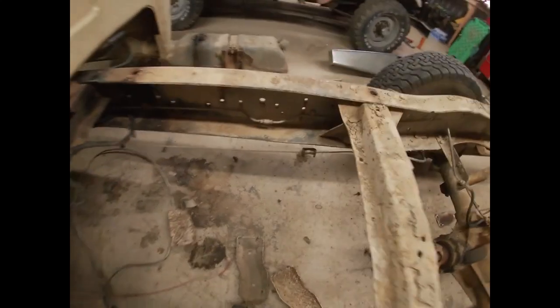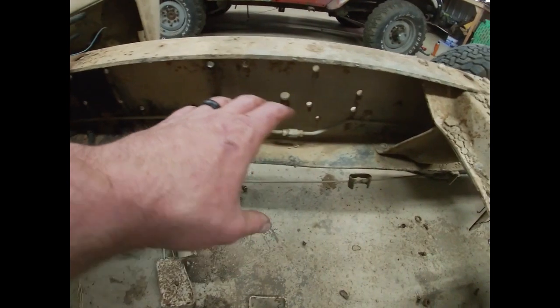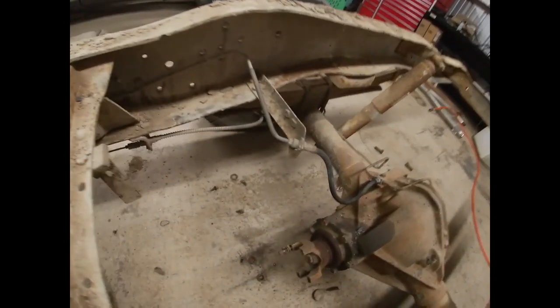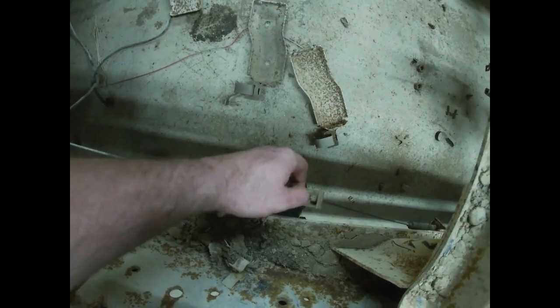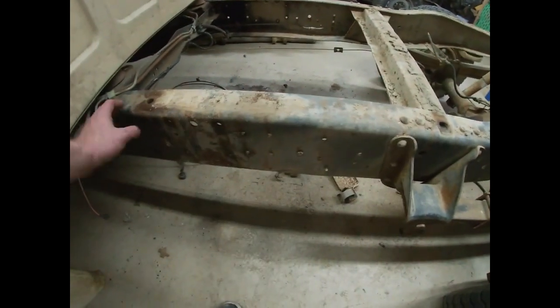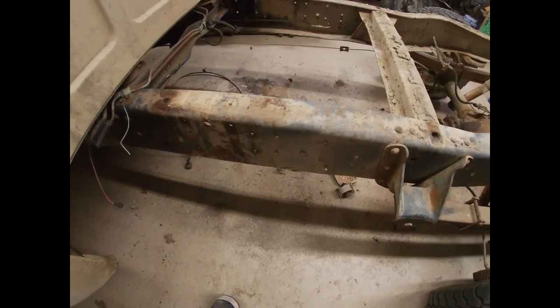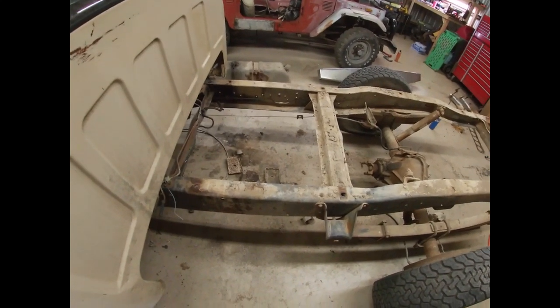All right everybody, we're back at it again. I'm going to show you a couple things and then put it on time lapse to get it all ready. First thing I got to do is move this brake line - I'm going to undo that stock union right there and gently bend that side out of the way, then unhook the other side of the line. I also got to unhook my parking brake cables and get them out of the way, then clean this frame rail up real good where I'm going to be cutting it so I've got nice clean metal to mark on and work with.